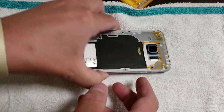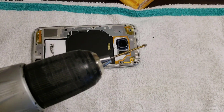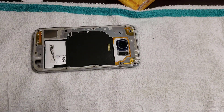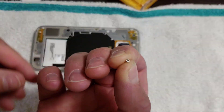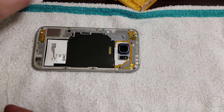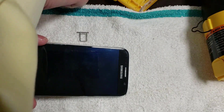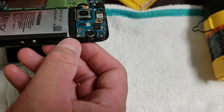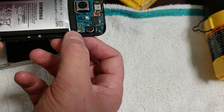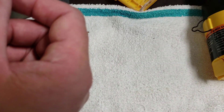I couldn't get one of these screws to come out — specifically this one. So what I did was very carefully drill it, which is quite a risky venture. It does work — you just drill out the head. The screw heads in particular are very soft. This one was stuck; apparently I stripped it. Even with an enormous amount of pressure applied, it just stripped. So then I heated it up again with the heat gun, took my credit card, slid it along until it popped, and bingo — it just popped out. There is a screw still there, and when it goes back in it'll just fit into the slot. It simply won't pin it down, but it will stop it from shifting. That, unfortunately, is about the best I can do.